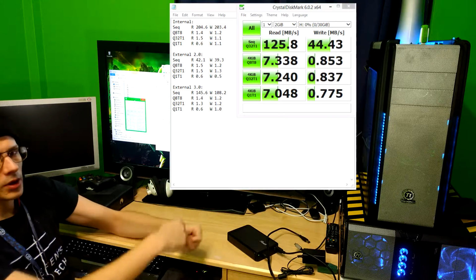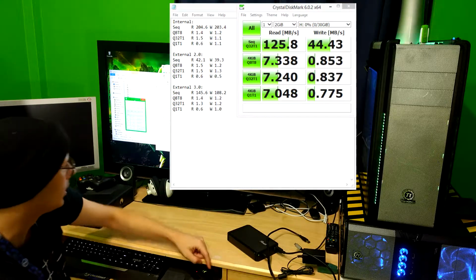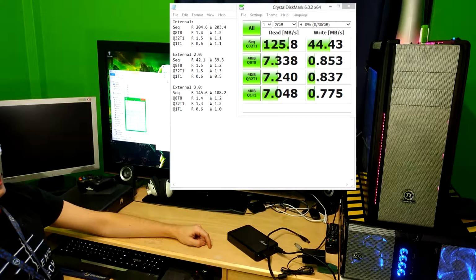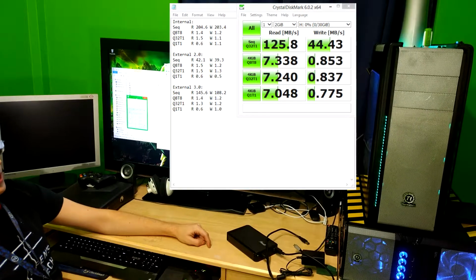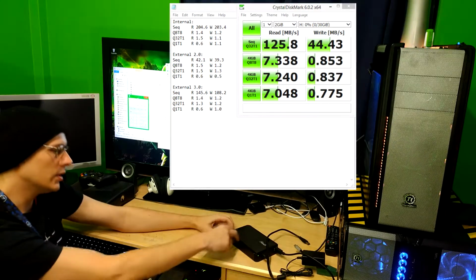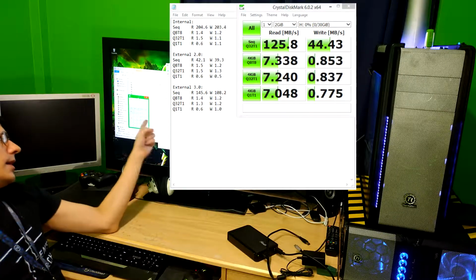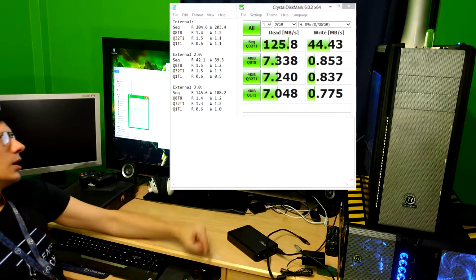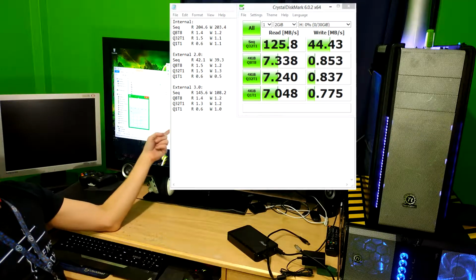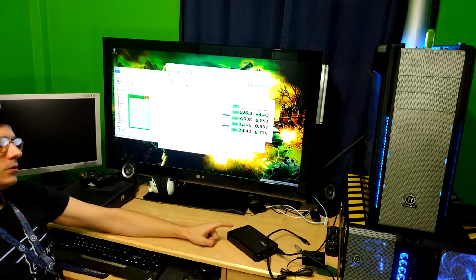Just plug in your SATA connection, and I said SATA there, but I said SATA before. I hate that word. I mess that up every time, eh? So anyway, just put all your movies on it when it's in the computer, and then shut off your computer or use whatever quick disconnect stuff. But anyway, all that matters is that you're safe about it. Then you take it out of your computer and put it inside of that enclosure, and when you plug that into your TV or whatever that you need to read all of the movies off of it, you're only about 1/4 of the speed less for your read speed. But at least you don't have to sit there and wait forever to write everything on it, because you'll be able to write all that information at 2 times the speed than you would if you just put it in there right away.